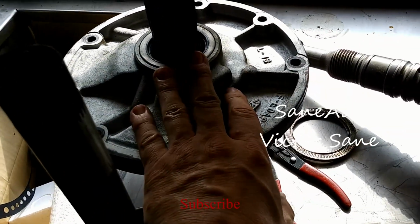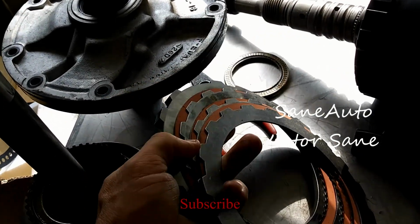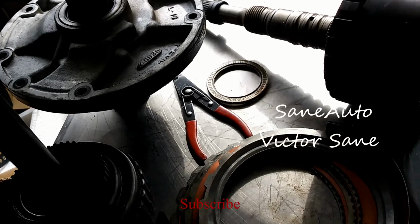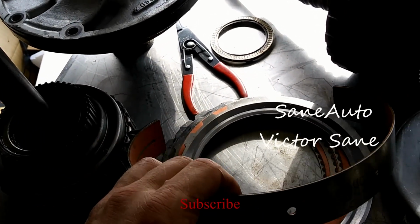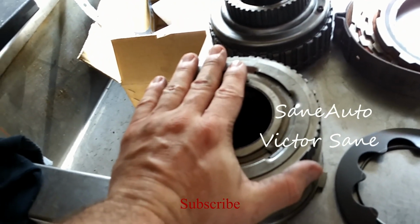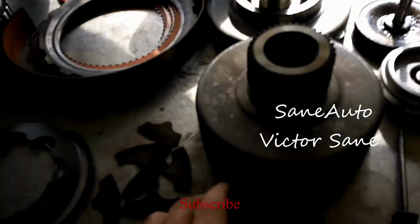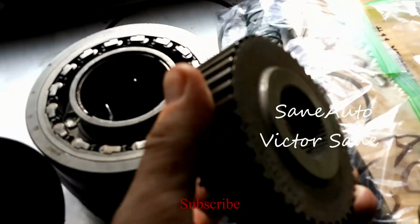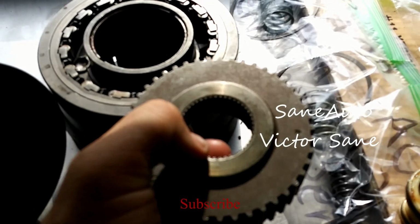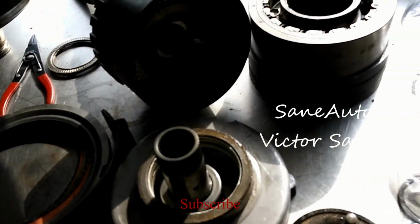Because when you take the pump out, you will first have your intermediate clutches and your band, and then you'll be able to remove the reverse input drum and then the forward clutch drum and then the forward hub. And you'll notice the forward hub right here, the hole in the forward hub is smaller than the direct hub, which we'll get to in a minute.